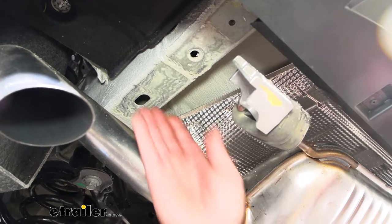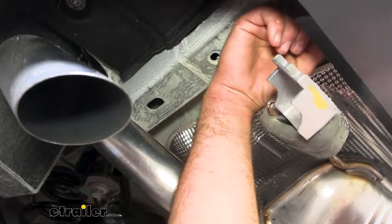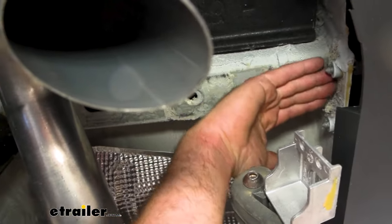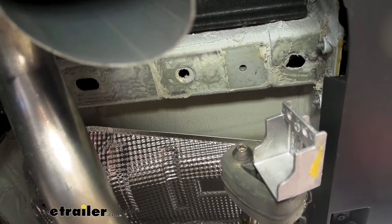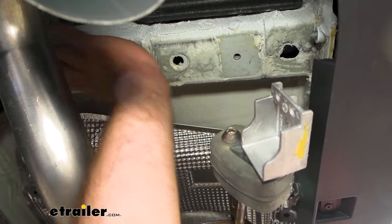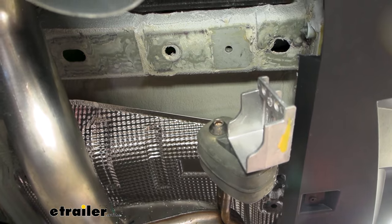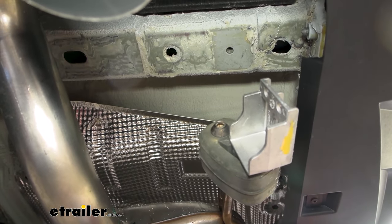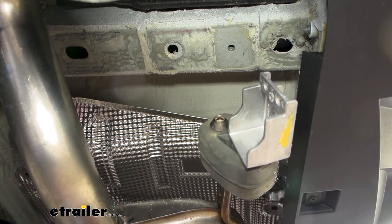So we scraped away our frame coating. It does take a while, and I'd really focus where it bolts up to the bumper beam because that hitch lives right here — any of that is going to potentially make it hard to line up with the holes. Really take your time on this edge and make sure it's pretty well flush, because you want that hitch to sit against it and not have gaps in between. That process is messy and a little tedious, but you'll only have to do this once.